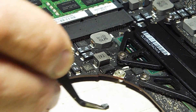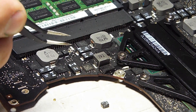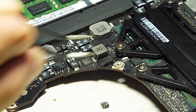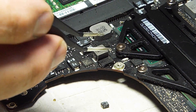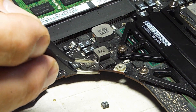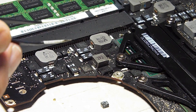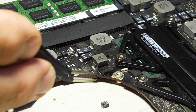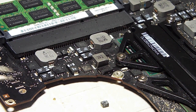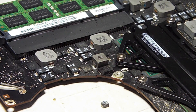We've replaced this chip with the new one, putting the bar towards the heat sink — the positive side. It looked like there's clearance there, so everything looked okay. Assuming we got a good connection and didn't ruin anything with too much hot air, which is a very real possibility. This is do-at-your-own-risk; you can have this repair done professionally. Back up your data and all that good stuff before you work on your computer. We're going to put it back together and see if the machine comes on.